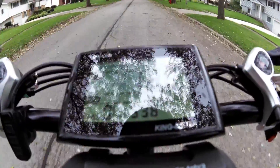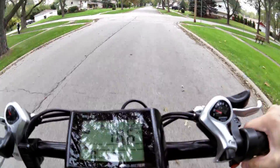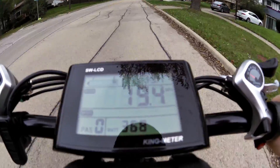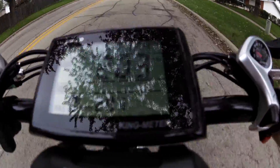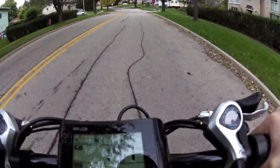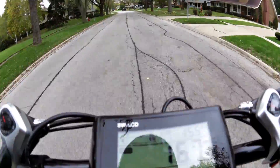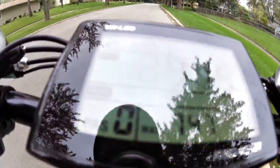I have noticed that since it's at one bar, top speed is now only around 18, 18.5. Yeah, full throttle right now. With the wind kind of at my back, with one bar, I got just about up to 20 — at 20.3, 20.4, 20.5. With 5 to 10 mile an hour gusts, I got up to 20.5. So at one bar, power is definitely decreased. We're at 17 miles, still at one bar. This thing will not die.